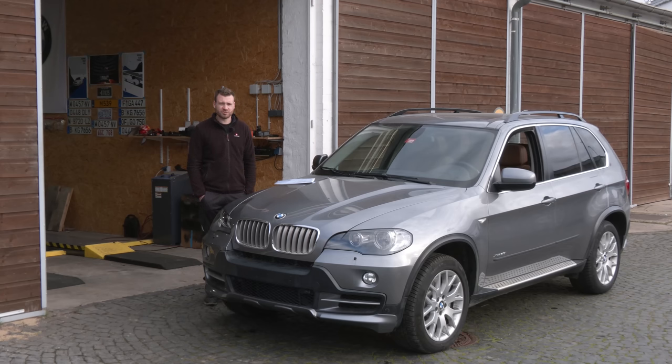So what I had to do is reach out to Oli from Oli Motors, who is an awesome guy. He's always been there for me whenever I needed any help with coding or whatever. He was able to connect with his laptop remotely through my laptop to the computer, and program the DME to Euro 4 software, ECE software. In fact, the DME was already programmed back in 2014, so all he did was confirm that the car has Euro 4 software, wrote me a paper that the car has that and that part number and it's Euro 4, and I gave all of that to the TÜV inspector, and he was able to inspect the car with that.